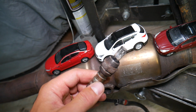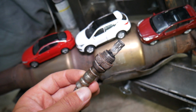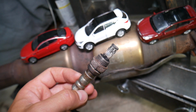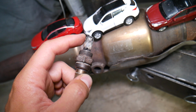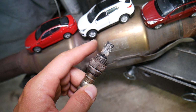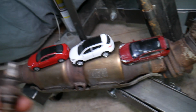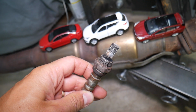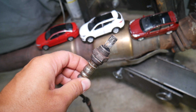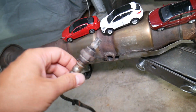Things that you need to check: it could be a faulty sensor. If you want to see how to test a downstream oxygen sensor, we have the video on our channel, check it out, it's pretty easy. Number two, it could be a plugged up sensor as well. If your car uses quite a bit of engine oil, it could be a dirty sensor where the holes are not getting enough airflow. In that case, your car may be burning engine oil from something simple such as a bad PCV valve or separator valve, and as a result you may have increased oil consumption that can make those dirty.